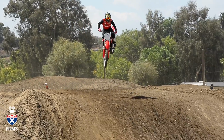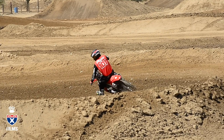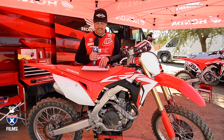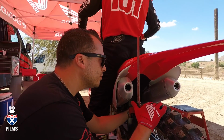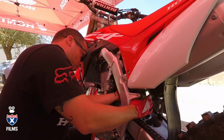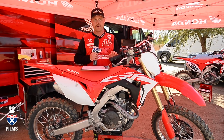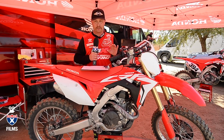What Honda here, the media department and the testing department, the guys that have put a lot of hours on this bike, say keep your low speed at 10, high speed compression at 3.5 out, rebound at 6 out, and sag at 107. And that 107 number is key. They said that, as with any bike, balance is key, making the thing not be high or low in the front, and that 107 number is where you want to be. They've had a lot of luck with that, so don't stray from it. I set my sag at 107 and we got it to work great.